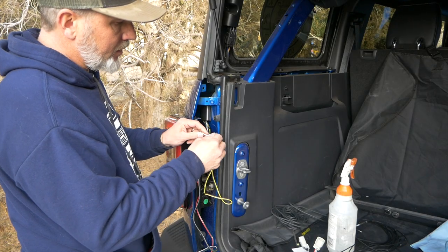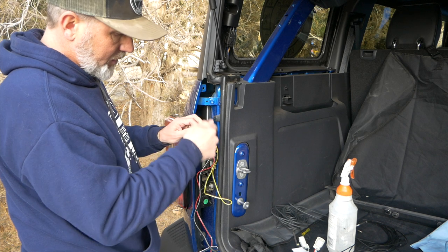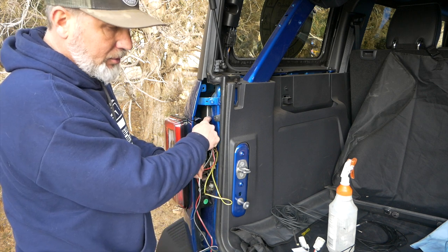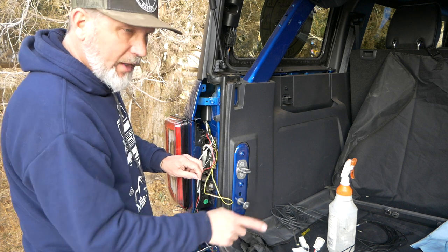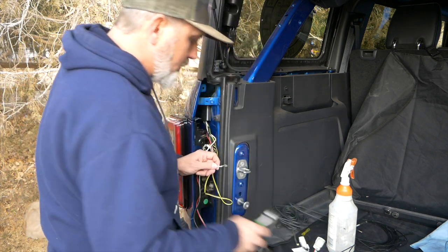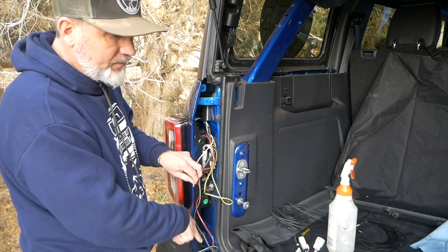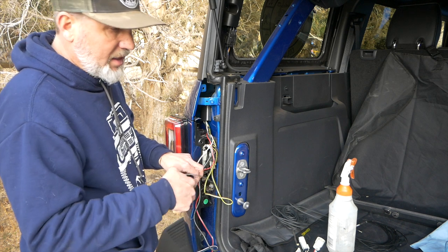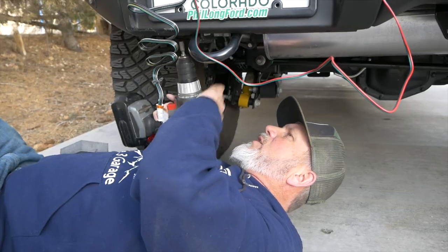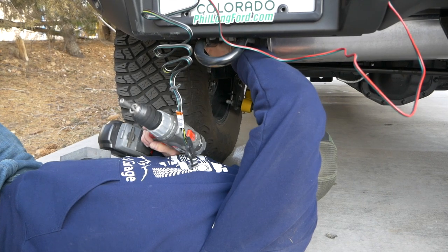Next is to run our ground wire. Theoretically the ground wire might actually be able to ground to aluminum, but I'm actually going to ground this to the frame. Because I'm mounting my box in here, most people mount it underneath the bumper, which you can do — you can actually mount your modulator box underneath the bumper. But I wanted the modulator up inside the vehicle. So I'm just going to snip this off, run a connector to this with a little bit of 16-gauge wire, and run it straight down to the frame and zip a screw down into the frame so I know I've got a good ground. That's a good sturdy ground.